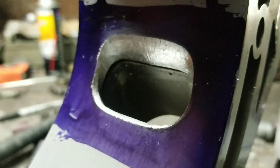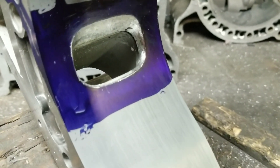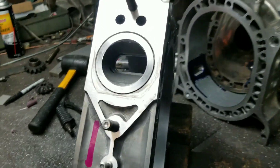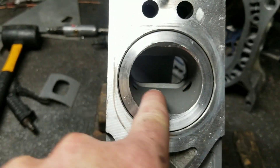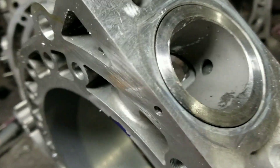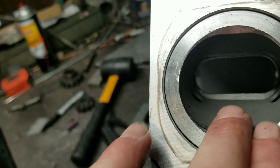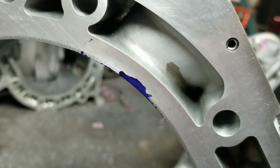We've matched the edge of our port. Now we're going to be coming back in and flipping it one more time to match the inner Inconel sleeve. Third direction — we're going to be porting in now through the exhaust port to blend in this lower edge with the Inconel sleeve, completing our radius of where the exhaust air is going to flow. Not only are we trying to provide the air a good path, but this Inconel sleeve is providing a heat barrier block for your water cooling passages. So it's important.